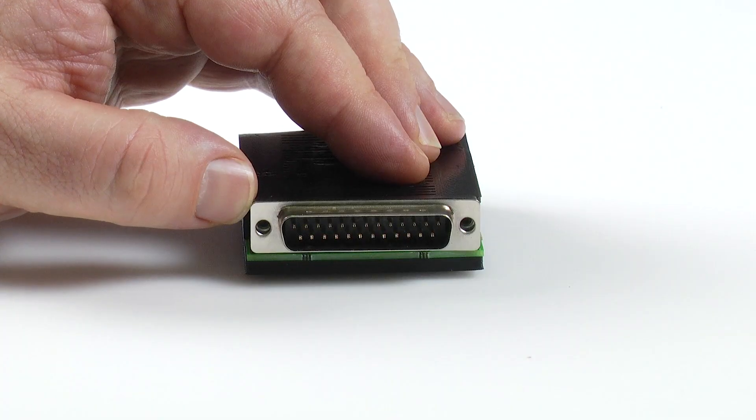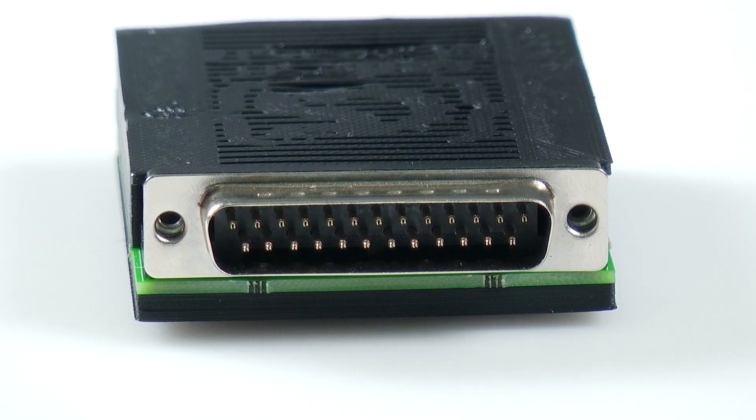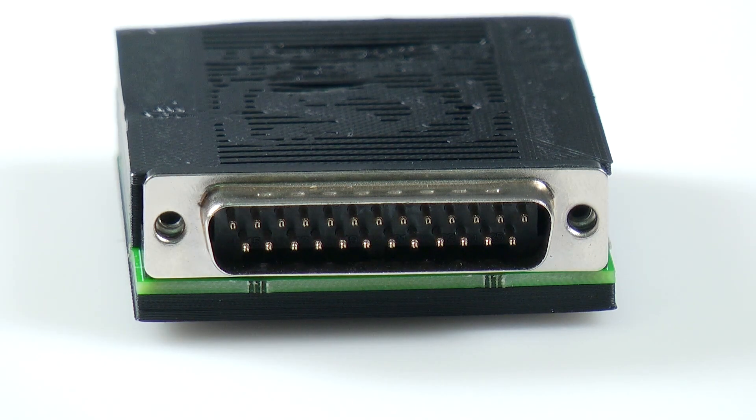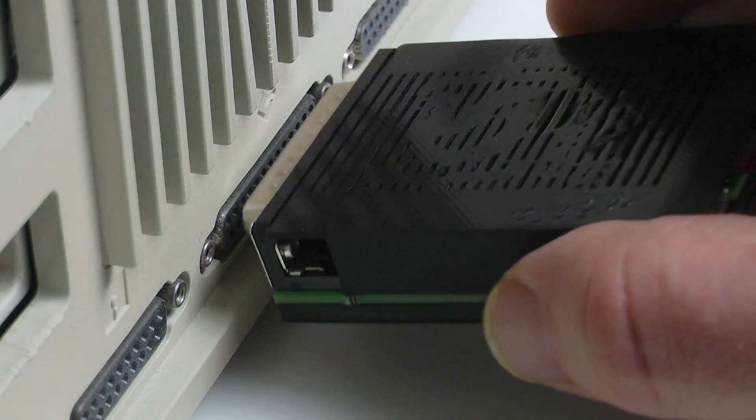As much as I like the version 5.5 it's not perfect. Within only a couple of uses the shield from the D-sub connector fell off. I'll be able to rig up something to permanently attach it but it was a little disappointing, especially after happening so quickly. The other issue relates to a bit of plastic at the bottom that juts out enough to stop the drive from being plugged into quite a few Macs. For example the Mac 2CI has a little lip at the bottom of the case and that plastic stops the drive from being plugged in. Once again I can resolve this by shaving off a few millimeters from the bottom case plastic, but it's another thing that probably could have been made differently. On the whole though I love this device — despite its flaws it's an incredibly useful piece of kit.